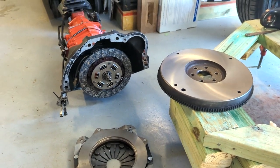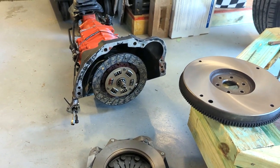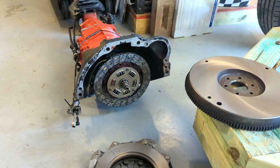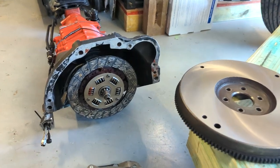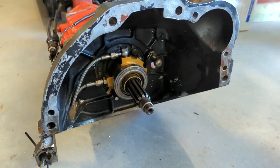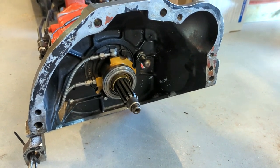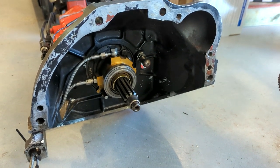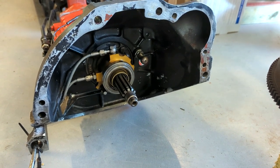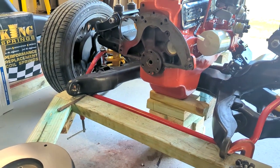The only thing I've got to check is the Malwood — I think they're called an ace bearing — the throwout bearing on this gearbox. If we come down here and just slide that off, you can see the throwout bearing that comes with the Malwood kit. I just want to check that setup and make sure it's right; there are a few packers that go behind that bearing to get the right pedal feel. I want to recheck all of that before I put it in, then I'll start assembling this all up and getting it onto the motor.